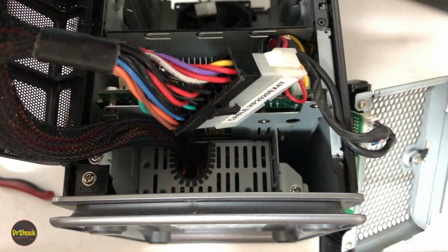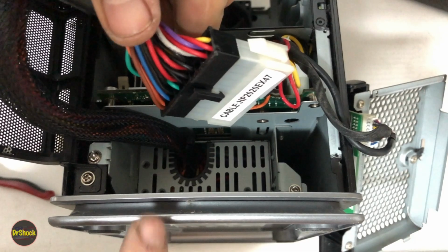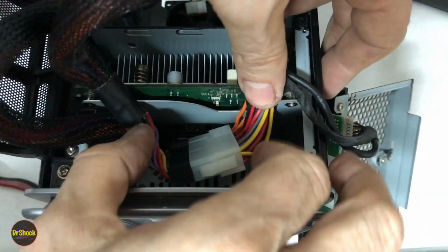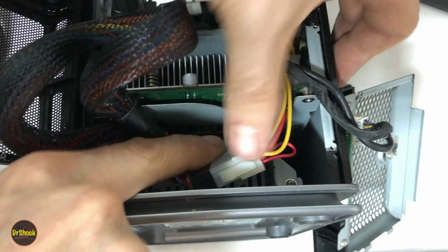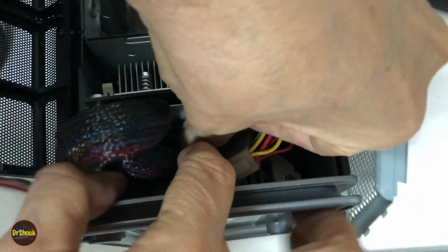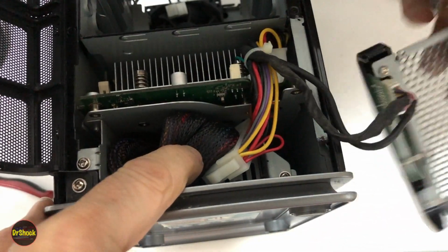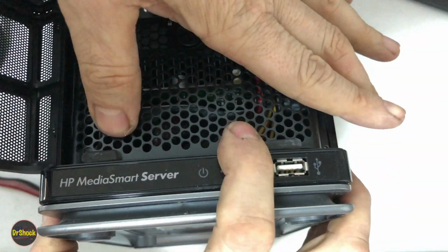This orientation so you can see how to get the cable adapter and the cable from the power supply to fit into the limited space that was originally there. You used to be able to get these power supplies pre-wired for this proprietary kind of HP connector, but it's so old now, we're lucky that somebody even makes an adapter. All right, so we're going to push the cable connector for the adapter and the original cable in first so that we can get the clearance we need to put the cover on. And then we're going to put in this little braided wiring cover that covers the primary cables, right? And that'll sit like that. And that'll give us enough clearance to get the cover on. Like that.